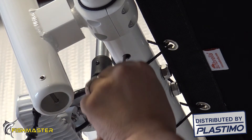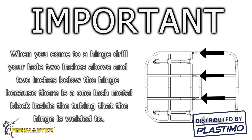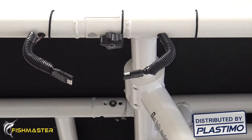After drilling the holes, you can start inserting the wire on one end and pulling it out the other end. Important: when you come to a hinge, drill your hole two inches above and two inches below the hinge, because there's a one inch metal block inside the tubing that the hinge is welded to. Where the hinges are, you may want to put quick disconnects so that you can disconnect the wires when folding the T-top.